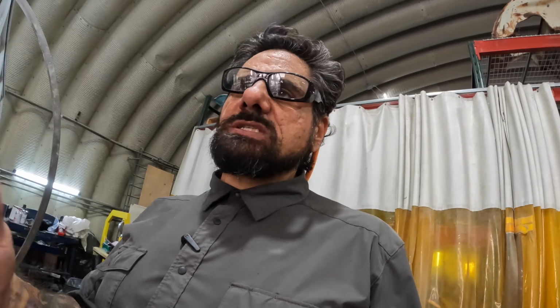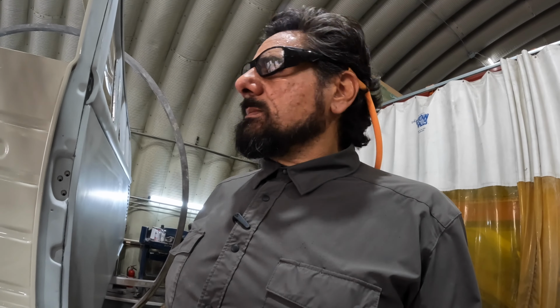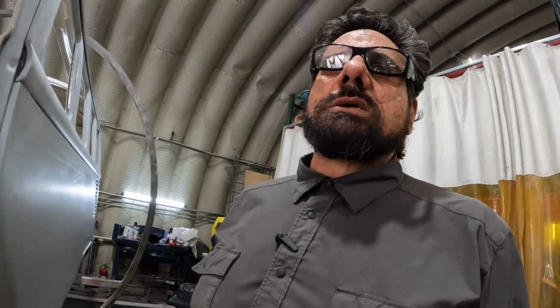And I know the factory didn't even do anything in the doors because they were just barely brushed on the foggiest coat you could see in there. But we're doing these cars better than factory. So if that's the case, do it accordingly. Put the extra material in the doors. Get that stuff sealed off, because that's where your cancer starts on these cars.